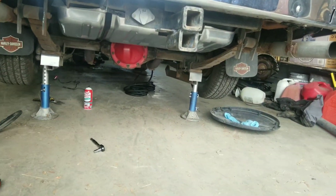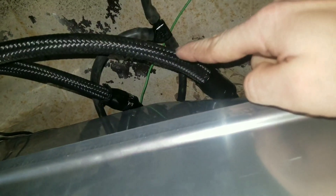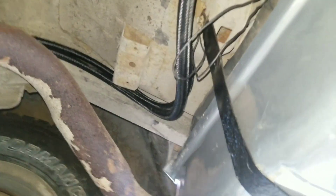So let me show you where I'm at with this. I've got it in, it's strapped up. I do not have my filler tube on yet - that's the next step. I do have my power wire to the fuel sending unit - it was the factory wire - it goes up into a grommet up there. I've got both straps on. Back here in the back - here is my feed, there's my return, here's my vent. My power wire for my fuel pump - I actually had a hole in the floorboard of the trunk and I threw a grommet in there, so it's running into my trunk. Not a big deal because I'm going to run it with the factory taillight wiring. I've got my grounds going to the strap mount for the tank.